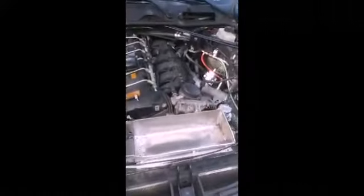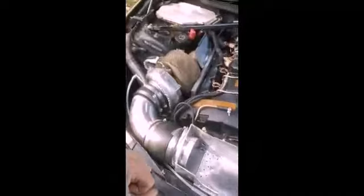Currently we're running just off the wastegate spring pressure. Wow, that's hot. I put in a 15-pound PSI spring in the wastegate, and that's enough. That's a happy medium for me to say, we can add a manual boost controller. We got rid of the boost box. I have yet to even turn it up. Don't mess around with it. Just go manual boost controller. Don't mess around.